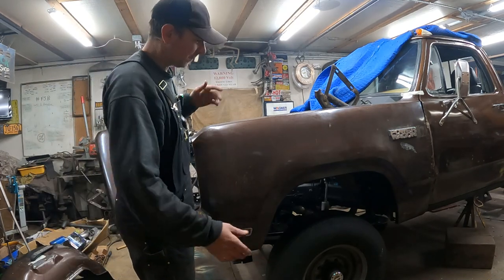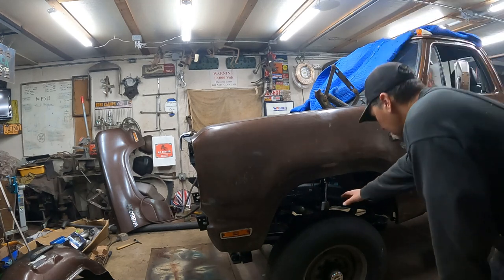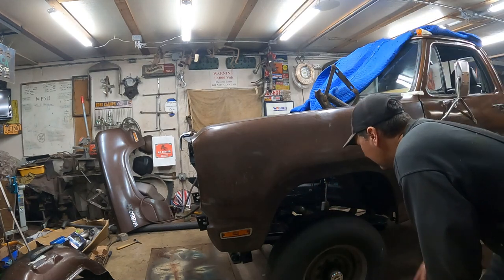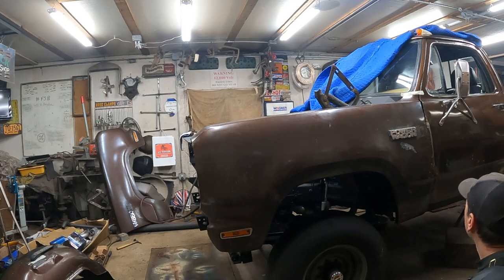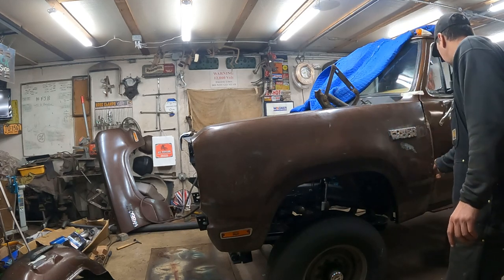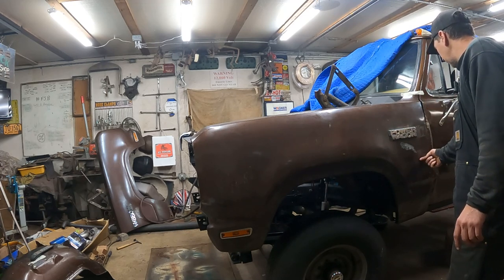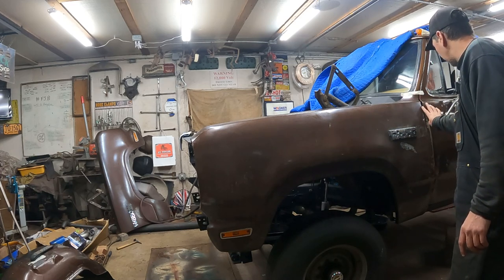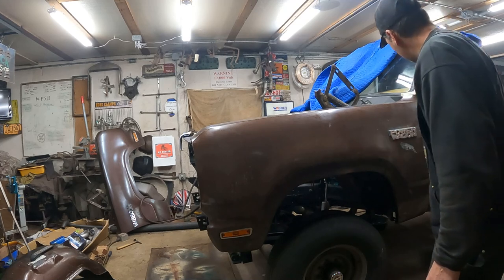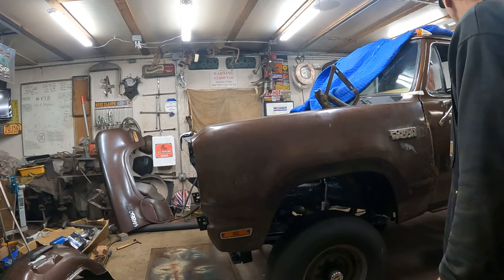I'd say we've got a fender most of the way on here. Look at the height with the lift — I'm going to put a little bigger tire on it, but she's going to have that factory high boy look. I've got a huge gap here on the fender and it's pushed out on the bottom. There's a screw that goes in the middle in the door jamb. I'll probably line that up with the door best I can, then pull the top of the fender out. This door is severely wrinkled.